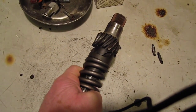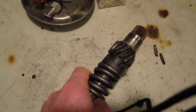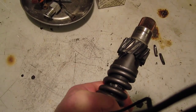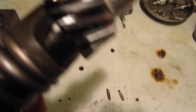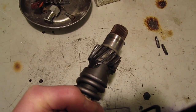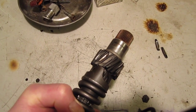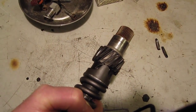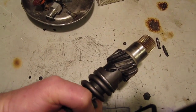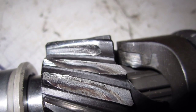This is the main issue - this helical gear here. You can see that there are a couple of teeth broken off, and there are the teeth as found in the bottom of the gearbox. These helical gears are the gears that mainly wear. There is one helical gear on each shaft and apart from the broken teeth, the gear teeth are very badly worn.